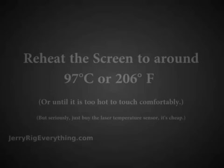You have about a 30-second window just because the glass is so small and so thin. It doesn't retain heat very well, so it cools down very quickly. And that makes it harder when you're trying to keep the glue liquid so you can separate the glass from the rest of the phone.